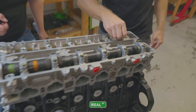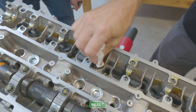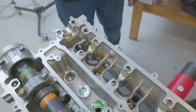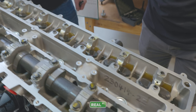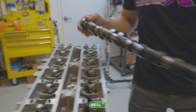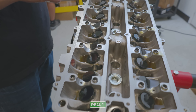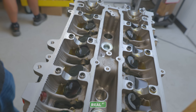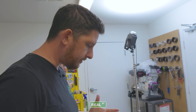These look pretty great. There's the tiniest little bit of witness on this very first load, looks like it's right around where the stand would be on the inner structure. OEM buckets usually show a lot more than that for a first lap or two. So these are the new Kelford DLC buckets. For about 20 years our best option has been the Toyota factory shimless bucket from the 2ZZ, and now we have a proper aftermarket bucket that's not only DLC coated, but the material itself is harder.